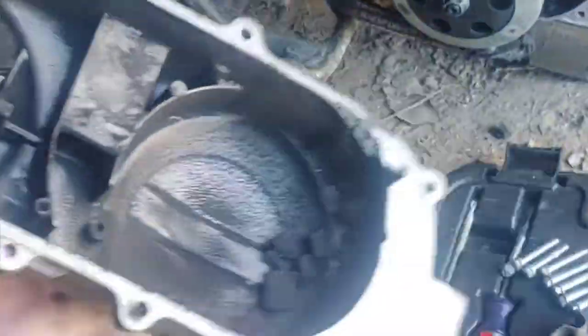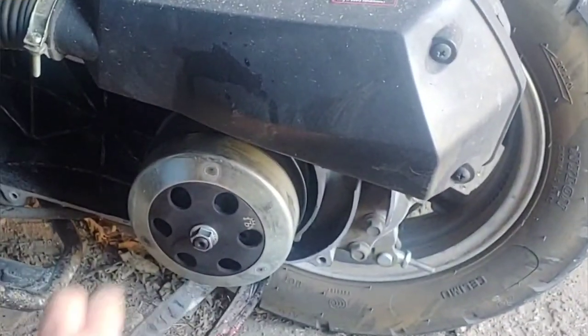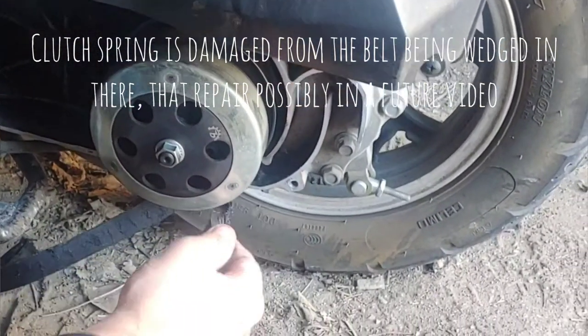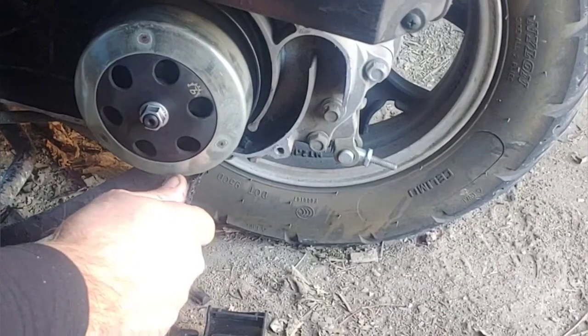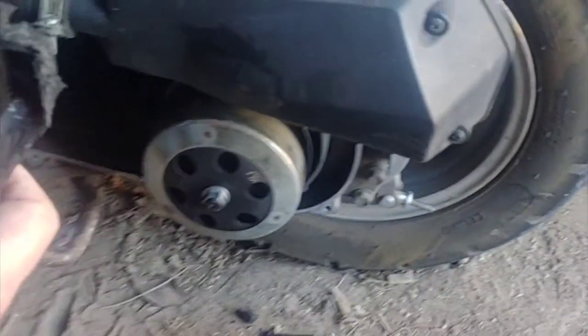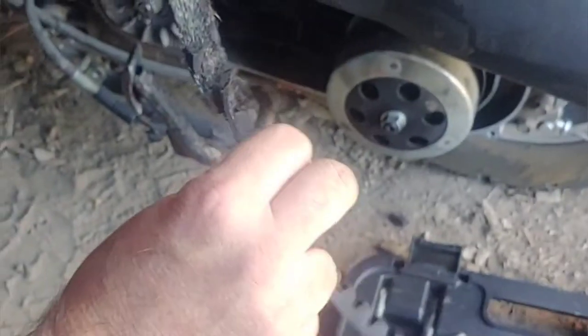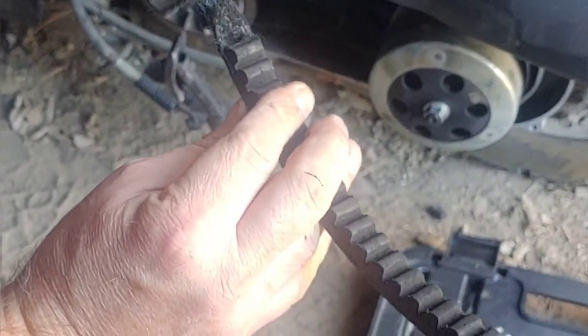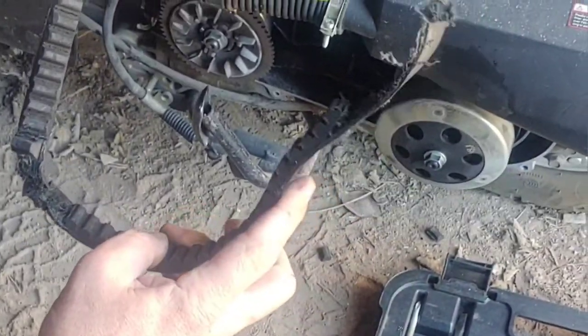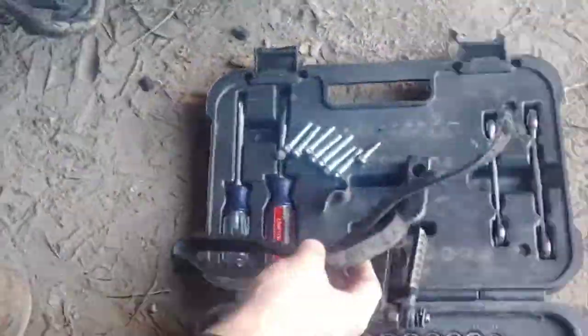As I get the cover off, you'll be able to see there's some chunks of rubber in there — a little bit of a clue to some later problems right here. The belt is wedged in the clutch itself, and it looks like it rode inside of the clutch for a minute while it was coasting, or something happened there. So the belt is chewed up. Definitely got to have another belt.